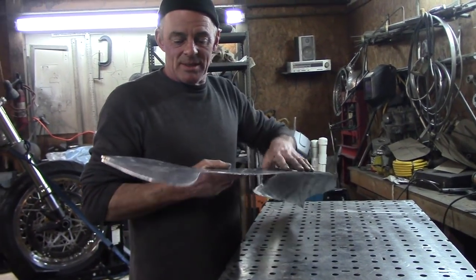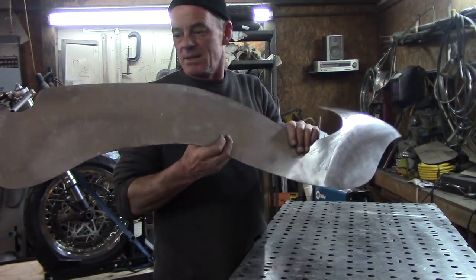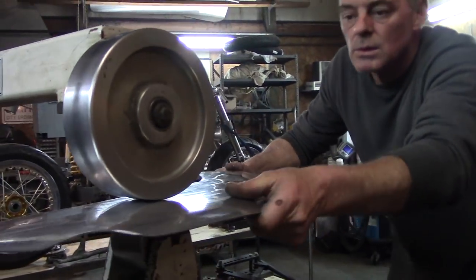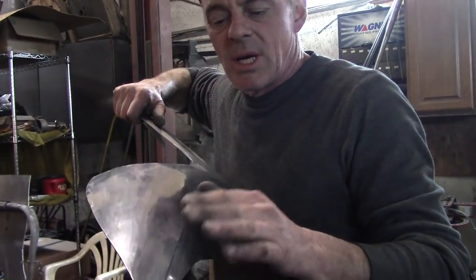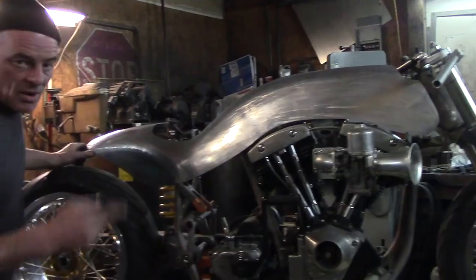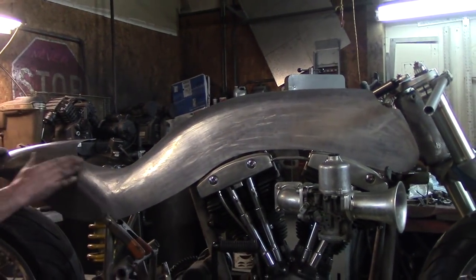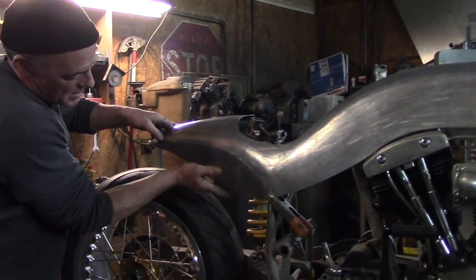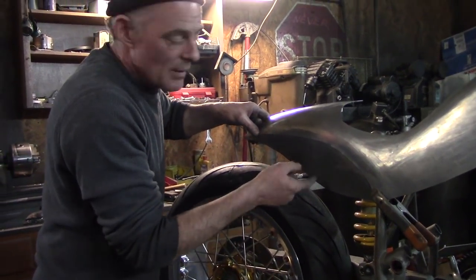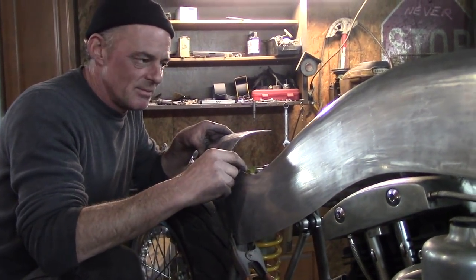Started doing the bodywork, laying out the cardboard forms for the tank. I'm going to do the whole side — see everything out of one piece, each side. It's a little kittywampus. I might have to give this a bit of a biff with the body hammer. Got the tank going right around the engine there. This nice line here — I'll make a nice crisp line. This will get folded under there. Beat the fuck out of it with the hammer, it'll go under. The seat here is going to be for skinny little buggers like me, not for big fat bastards.